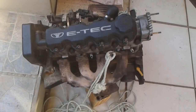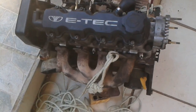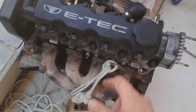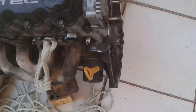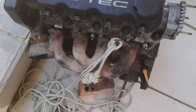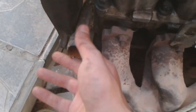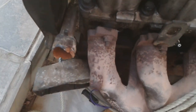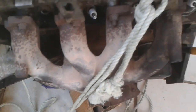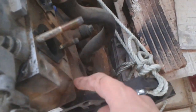Here is the engine replacement. The engine I'm going to drop in visually has nothing more than what the engine the car already has. This hose outlet is rotten out just like mine, suggesting that this engine wasn't running on antifreeze. The good thing is that the head gasket is not leaking at least on the outside, though nothing tells me it's not leaking oil into the cylinders.